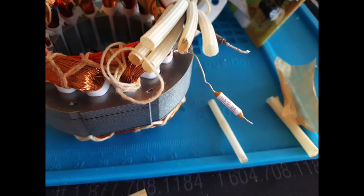So in review, this fan's repair turned out to be a blown thermal fuse that prevented power from reaching the motor. Not spending too much time on the circuit boards was a good idea. Now that the fuse is replaced, the motor works perfectly and the fan is fixed. I hope this video helped anyone with a similar problem. Be very careful when dealing with these appliances since you're dealing with high voltage — all of this repair work was done with the fan unplugged. Feel free to ask any questions and I'll do my best to answer. Thanks so much, have a great day.